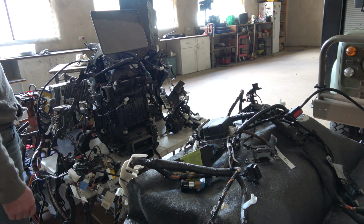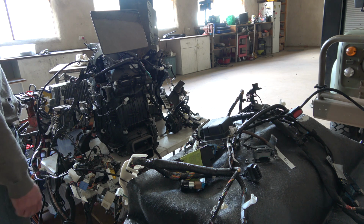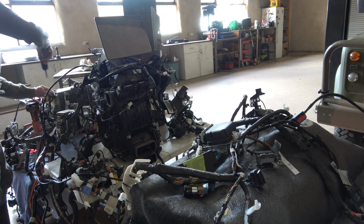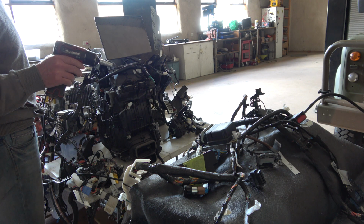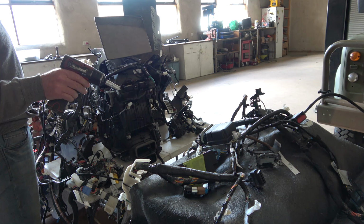I've filled up the coolant using a vacuum filler to try and get out any air. Put the battery back in, haven't put the negative on, that's the last thing. So, time to just connect it and see what happens. Could hear a clunk. Like any good project, problems are sort of inevitable. Pumps are going, there's no contactors clicking though.